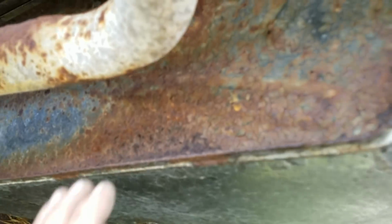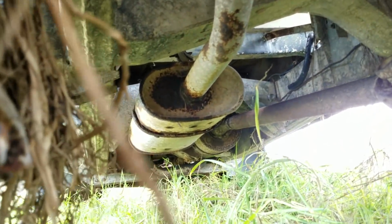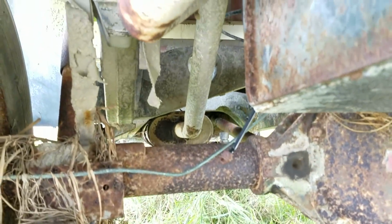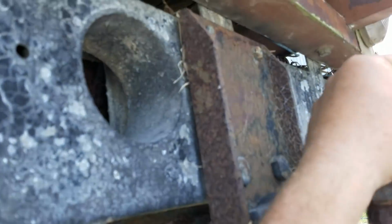But it looks like all I'll have to do is shout this thing a new pair of springs, a good sandblast of the rear axle, pay the exhaust system a bit of attention. Look how clean that chassis is. And there's a wee bit of rust starting in the petrol tank. I might shout it a nice new second-hand fuel tank.